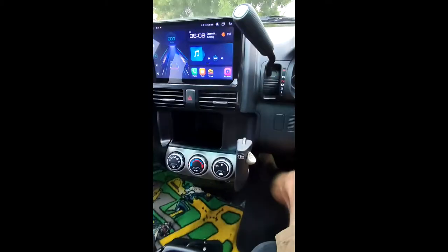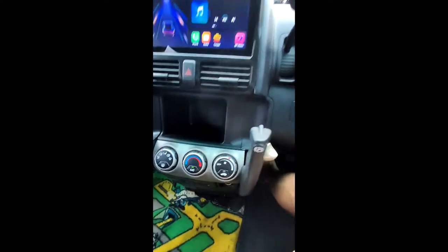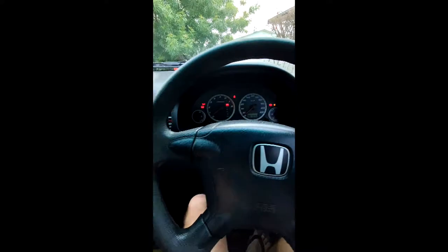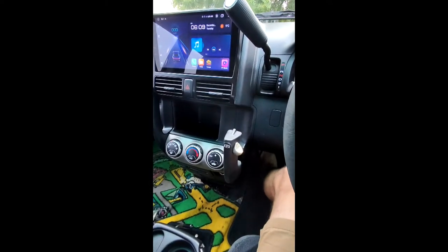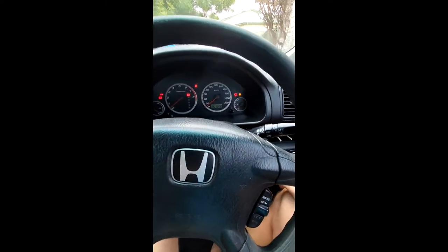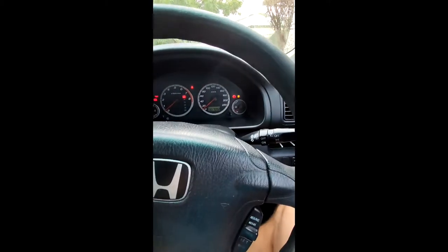What's going on with my car at the moment: I turn the heater on, turn the AC on, the light comes on, my RPM doesn't drop, and my car doesn't get cold - or the cabin doesn't get cold. I did get the aircon re-gassed last year. Granted I've only had this car for about a year and a half, so come up to a new summer, turn the aircon on, my RPM doesn't drop and it's not cold.